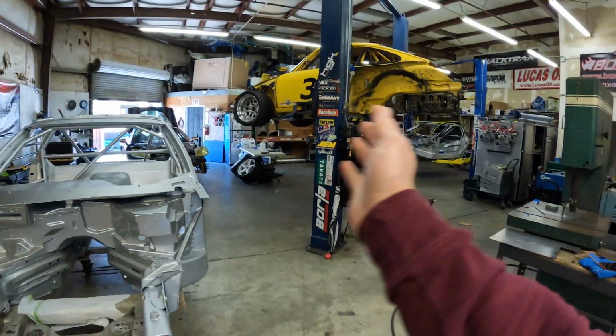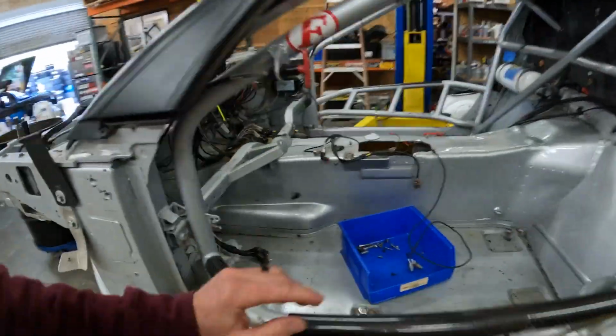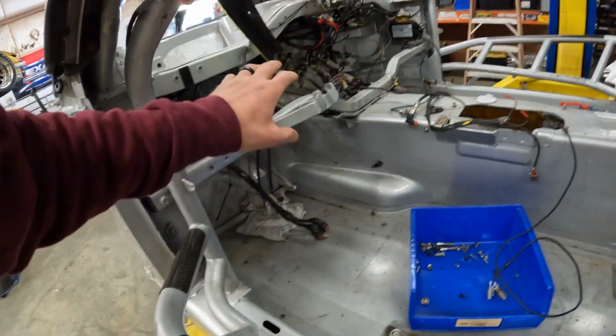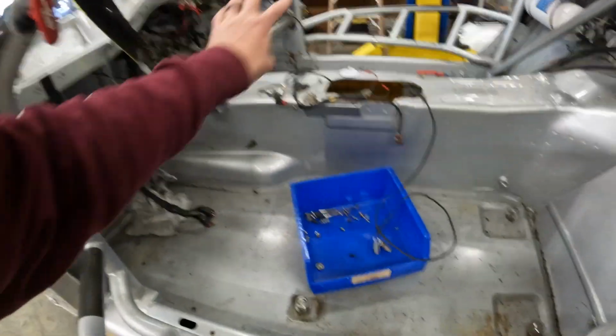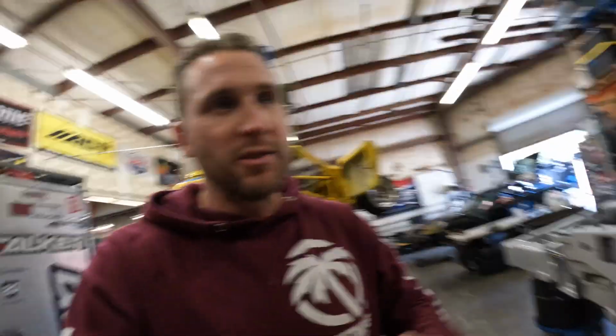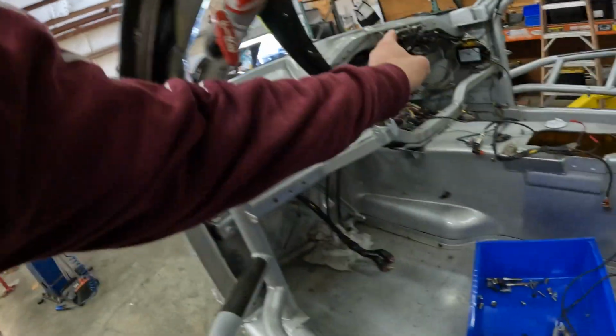So, now is the time. I need to make a little bit of room here. Boom, boom, boom. And gonna start transferring stuff over. That's why this has kind of been sitting the way that it is for the time that it has been. Because yeah, it's time. I'm gonna start mounting all the little boxes and PDMs and expansion hubs and modules and all that stuff. It's a lot of drilling and riv nutting, and then I'll start transferring the wiring over. So kind of gonna do that one at a time, do my best to mark these expansion hubs where they need to be, and go time.